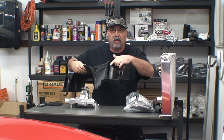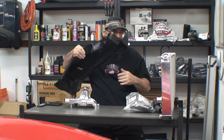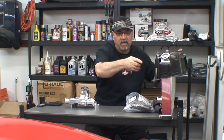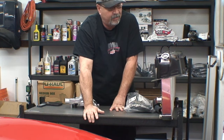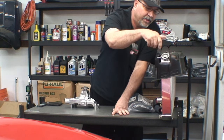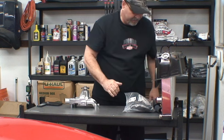I did have to customize the hole. If you go to an aluminum radiator, you will have to enlarge the hole here so the side flow of your transmission line can go through. And the bottom also on that side — you have to enlarge the hole for the bottom piece to fit over that. As you can see, I'm able to get to the radiator cap with no issues. I did get a round radiator cap, though, because there might be a little clearance issue with the regular style radiator cap. The round one is a much better fit for something like this.